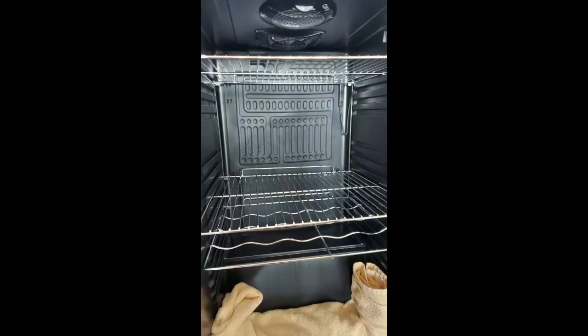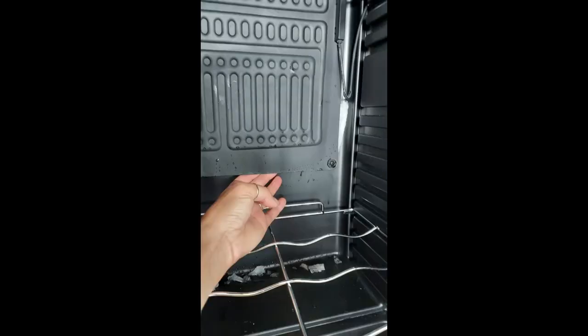Note that our fridge has a back panel. As the ice melted in front of the panel, we saw ice hanging from behind the panel — you can see the ice here. We waited another 15 minutes and a chunk fell from behind the panel all at once. Otherwise, you can wait until you see that no more water is dripping from behind before finishing this project.